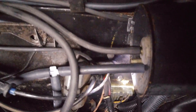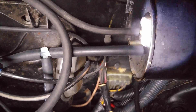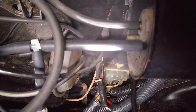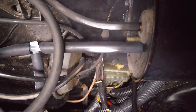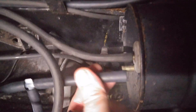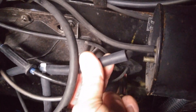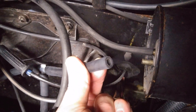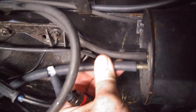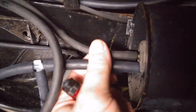You can see I left this vacuum line off and that's what's smoking. You kind of want to catch the light not directly on the part, but around it, so the smoke really shows up better. There's the smoke with the light, there's without the light — and there's the smoke coming out of this vacuum line. Let's stick the vacuum line back on. I just did that to show it off.